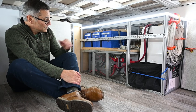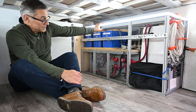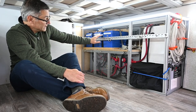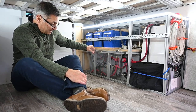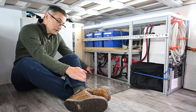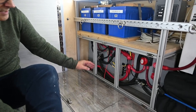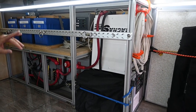Let me talk about the battery system. My battery frame is all made out of 80-20 and is bolted into the floor and wall of the van for maximum safety. I have three 100-amp-hour lithium batteries from LiTime, and these are all ratcheted down. This is my Lynx cutout that goes to my electrical system, and this cable is coming directly from the alternator — a 280-amp alternator in the front. With my battery system I have three ways of charging: number one is alternator, number two is solar, and number three is if I plug in my Magnum 4,000-watt inverter, it will also charge the batteries.